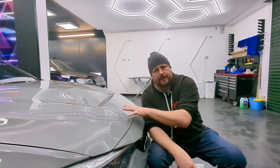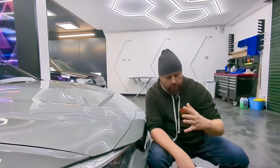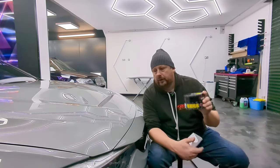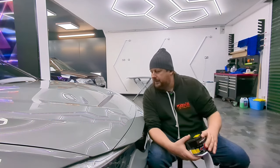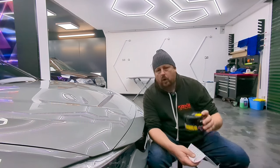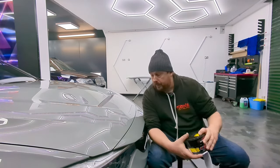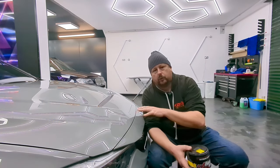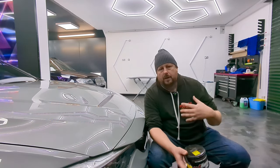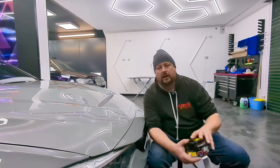Say you've got a freshly applied carnauba-based paste wax on your car and then you decide you want to top that with Fuso Coat. Well, Fuso Coat isn't going to be able to bond as well as it could to the clear prepped paintwork, and it won't be able to offer its full durability. It's also probably going to remove some of the baseline wax when you apply it because of the nature of the formulation. So certain waxes might be more suitable, or better to think of them as sealants, like Fuso Coat.